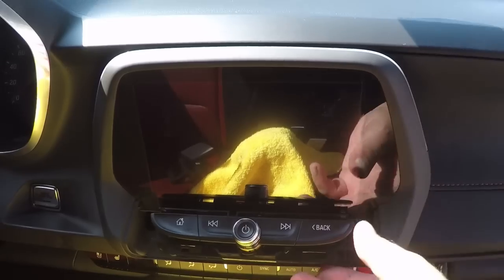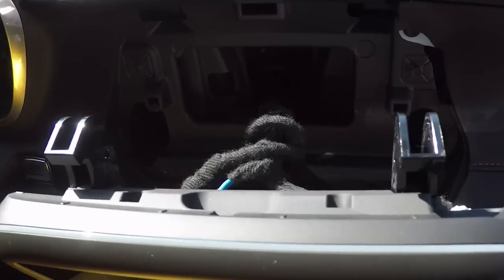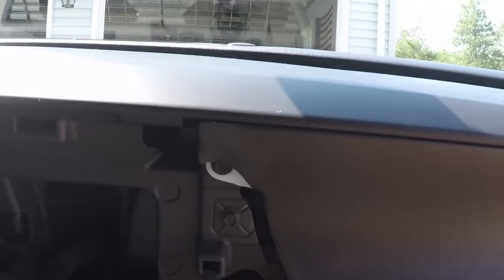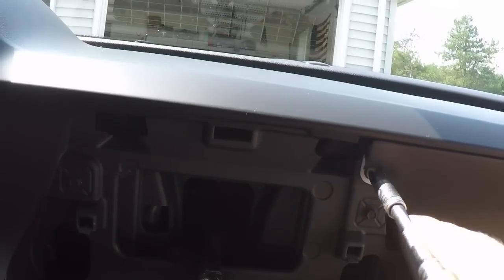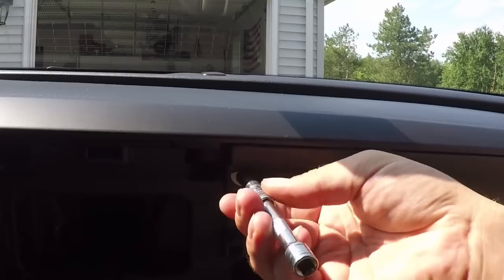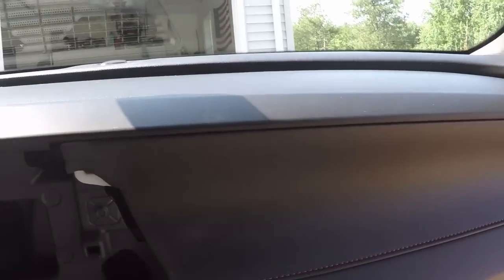Our bolts are out. Just kind of lift up on the bottom of the radio — it only hooks in on the top with plastic hooks. Now we'll set this down here with the wiring. Mine doesn't even touch the shifter, but on some automatics it is a lot closer. Next we need to get this bolt right here out — that's actually the only bolt holding this thing in; the rest is just clips that go all the way around. Keep in mind none of these bolts are super tight, so when you put them back in don't overtighten or you could end up cracking the plastic.